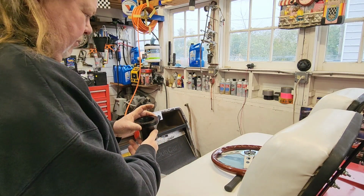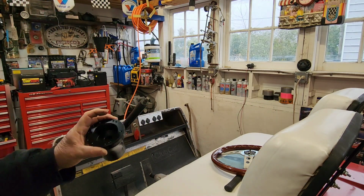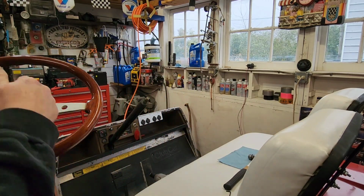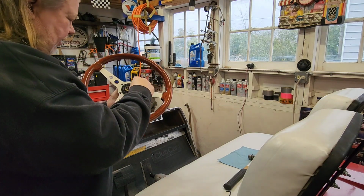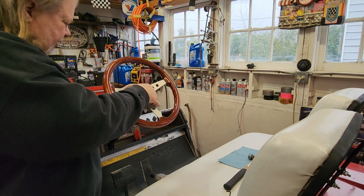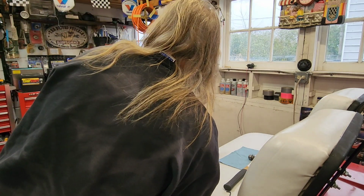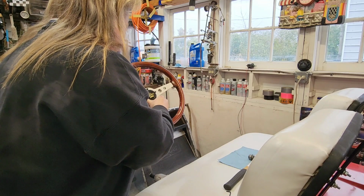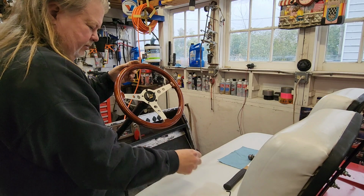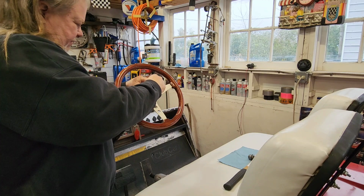Okay. In order to get the steering wheel kind of clocked properly, we're going to have to put a couple bolts in it temporarily. Alright, let me do that real quick. We got a couple bolts that came with the hub. Allen head bolts there. Just stuck them in a few threads so we can get this thing clocked properly. Like about there. There. Yeah, that looks cool. They come with an Allen wrench so we can put them on, take them back off.